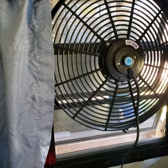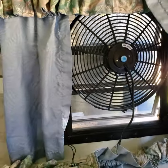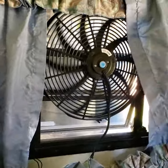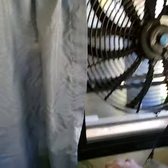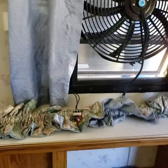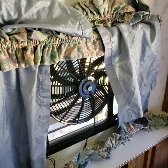That is a great thing to have. I've installed a couple on my new motorhome — one small one up by the kitchen to blow the air out. I like to blow the fresh air in, because the only thing you need to make it reversible is to switch these two wires right here. I'd rather blow fresh air in, because if it's blowing air from inside out it's going to pull warm air from under the refrigerator and other places that may be warm.